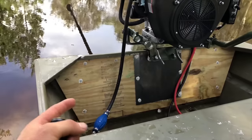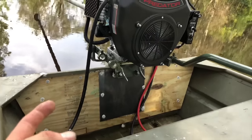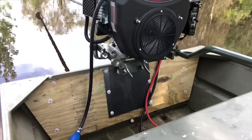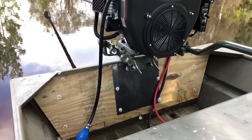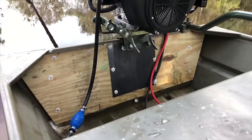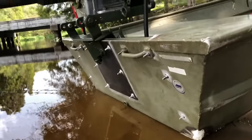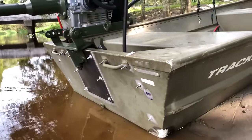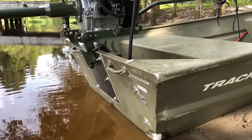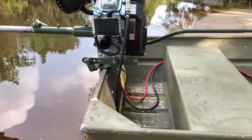What I did was I got three-quarter-inch plywood and put that across the back, and then I got two steel plates. Here in Florida, these steel plates are like 12 by 12, and they were $7 from Tampa Bay Steel — that is an absolute deal. Something like this from Lowe's would be like $30-something. So I got one on the inside and one on the back. That back plate is holding a lot of the motor. Before, the motor was bending backwards and bending that transom, but now with the steel plate, the new back transom board, and the steel plate on this side, this thing is sturdy as a rock.